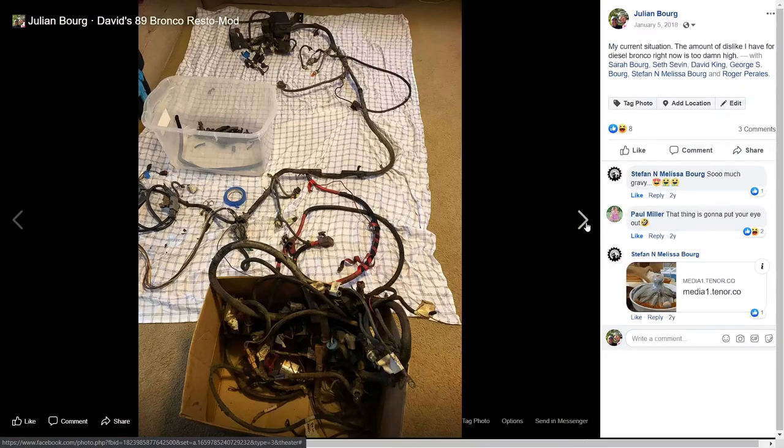This began what is most likely the bigger part of the nightmare, and the question I get most about the diesel Bronco: how did you do the wiring? If you're doing a brick-nose to an arrow-nose conversion like we did, a lot of this mess is self-created because you have to adapt two generations of harnesses to talk to each other. But if you're doing arrow-nose to arrow-nose, 98% of that goes out the window — you can literally strip the Bronco's harness and drop the F-250's complete harness in.